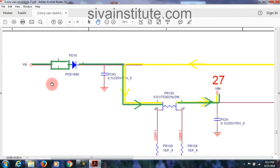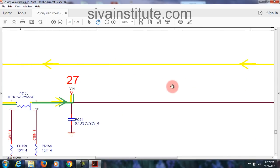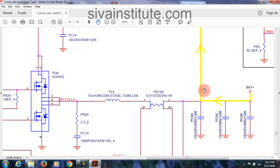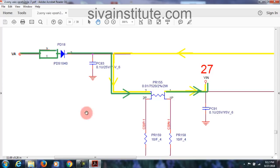Mixing these two voltages — so in here, this voltage comes to charger IC. Changeover — that means when you connect the adapter, the laptop is working with adapter only. When you remove adapter, immediately battery connection will come, battery voltage will come — this yellow color line. See here: any problem in this FET, battery won't work. From battery connection, this comes here. Any problem here FET, battery won't work, but adapter is okay. Any problem in this line, adapter won't work. Any problem here, adapter and battery won't work — both.